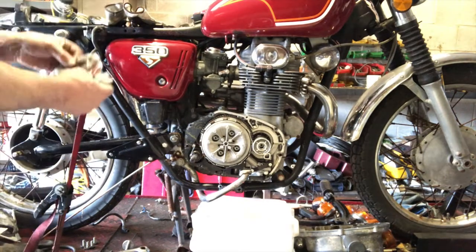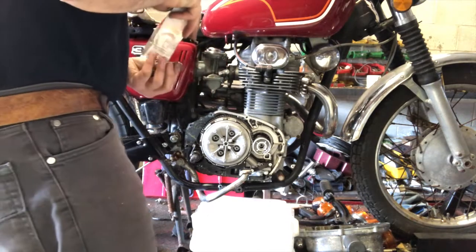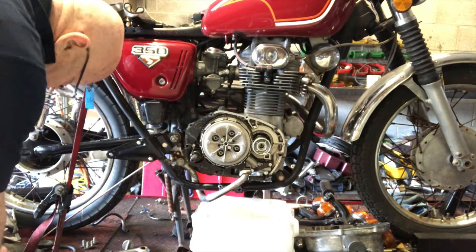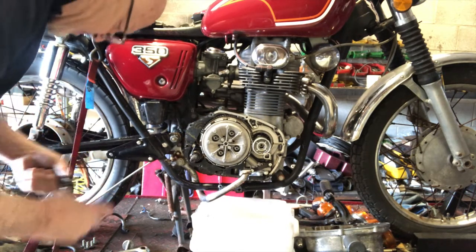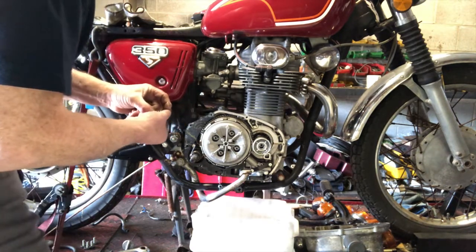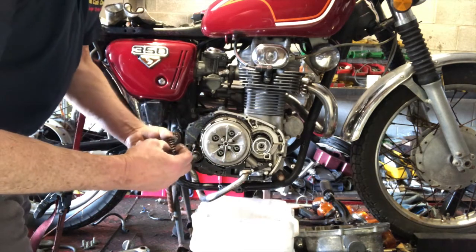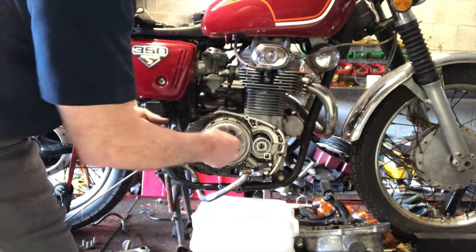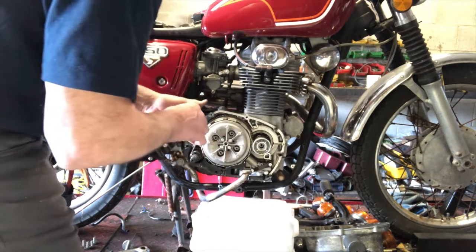Let's get our new springs out. Just compare one with the old one. Okay, if anything it's slightly shorter. Never mind. There are no closed coils on these either. By closed coils I mean the coils of the springs don't appear bunched up, because that's often an indicator which way they have to go in, bunched up at one end.